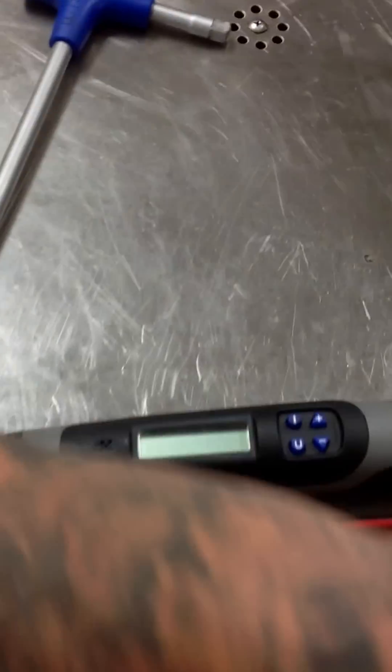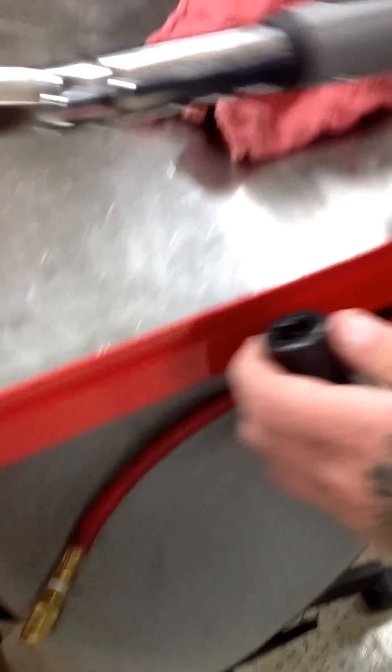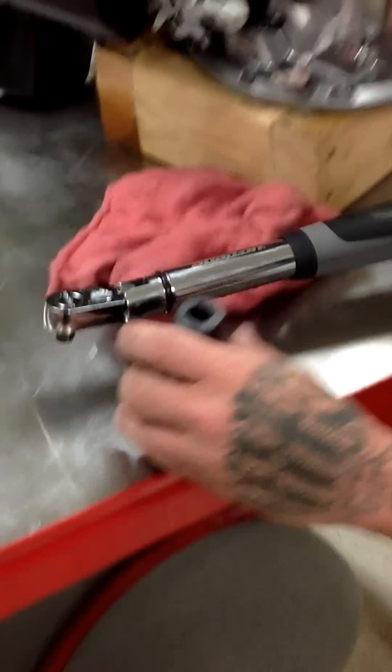Now another thing we have is a Snap-on digital torque wrench. Go ahead and just unthread that battery compartment real quick — you don't have to take it all the way out, just loose. Now thread it back in. When you let it sit for a little bit, that just has an automatic reset in there. We're going to torque this to 55 foot-pounds, so we want to do at least two steps — we'll split that difference. What are we at right now? 31. Okay, so he's going to hold it, and we'll go ahead.